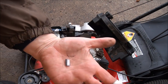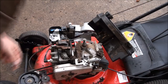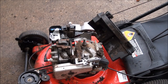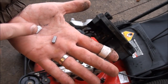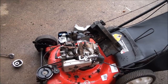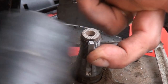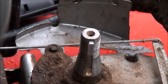And that's what you call a boogered-up flywheel key. We'll want to clean this all off so our new key fits perfectly. You can see this is what a normal Briggs and Stratton key looks like for this engine, and that's the damaged one. We're just going to put the new key in place — however you want to do it, in the flywheel or in the shaft — and then put things back together. Normally what I do is sand all this down for a nice smooth surface before we put the flywheel back on.